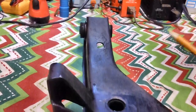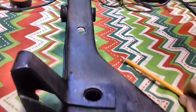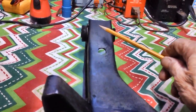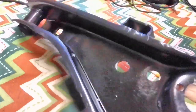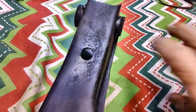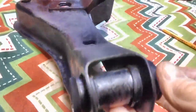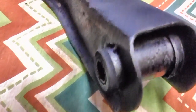Today, the first thing we're going to do is go ahead and remove this bushing back here that's been welded into this lower control arm. Now, this lower control arm has been all de-rusted and it's been sprayed with rust reformer — that's why it's all black. On the other side, I finished it and you can see how nice and pretty it looks. But I didn't want to do it until I get this bushing out because I have more rust up underneath that bushing. I want to put the rust reformer up in there, but we have to cut through these welds.